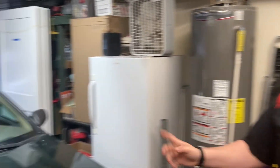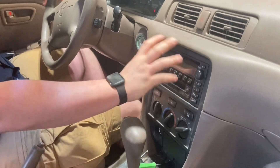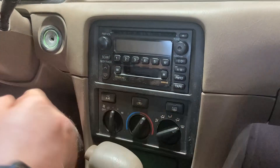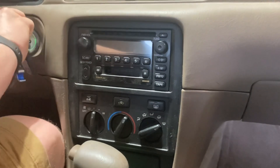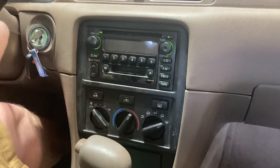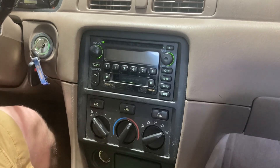We're going to hop into the car. When you come inside you can see the radio head unit and the AC system. The first step is removing the bezel that goes all the way around. To do that, put your key in and turn to accessory with your foot off the brake, then press on the brake and pull the gear shift all the way down to low to get it out of the way.